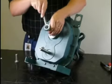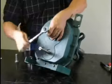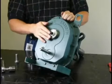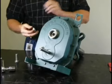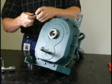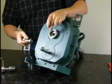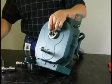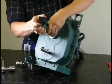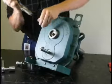The next step is to remove the keeper bolt from the driveshaft. With your keeper plate on there, run the removal bolt through the keeper plate and pry the wedge out. To do that, you've got to get under the snap ring — take your snap ring pliers and remove the snap ring that's currently in the plate.